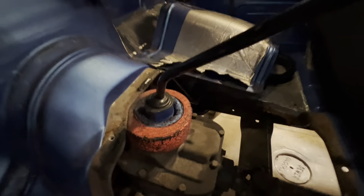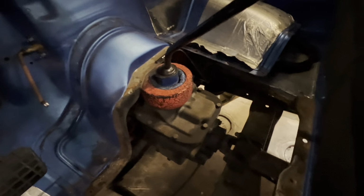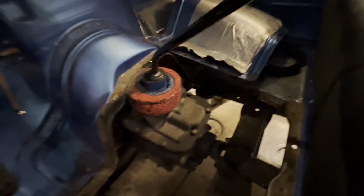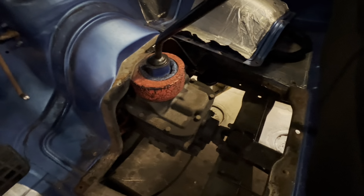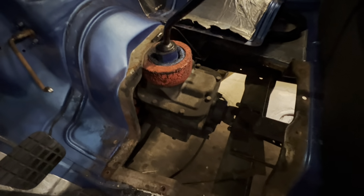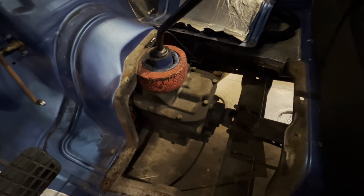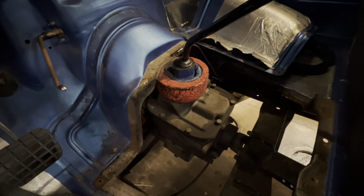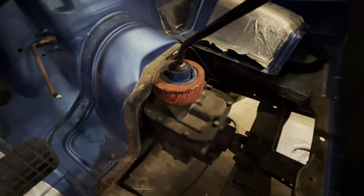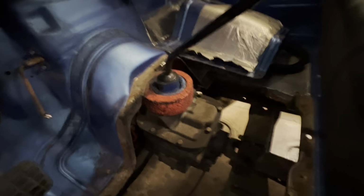Now I'm going to pull the Allen's or drift pins on the shifter, which I probably don't even need to. I bet you I can get this thing out without taking the shifter off. And put the car up, take out the transmission. And then we're going to be relocating the trans crossmember, taking out one of the crossmembers. It's actually a trans reinforcer or frame reinforcement. And then fitting that new one. So here we go.